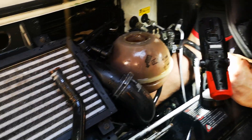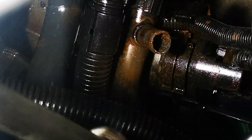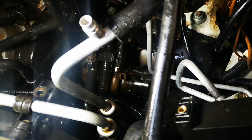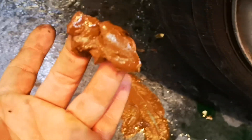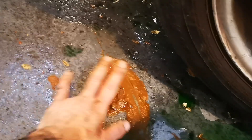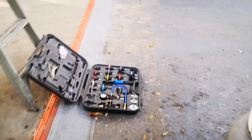We went into the red with it thinking it'll unblock — it didn't. Only once we opened this T down here did we find it. That hose there was completely blocked. The hose connected to it was so blocked that's what came out of it. And this is electrolysis — it looks like mud, but it really is the metal that's moving around with electrolysis.